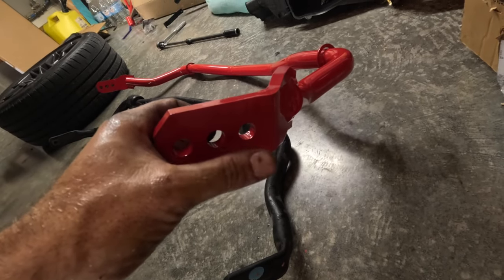Right off the bat, the adjustable sway bars are probably the first thing, or one of the very first things, you should do on any Mustang — especially the S650. It's incredible. It's my first time with an adjustable sway bar setup, and I don't know why I never did this before. I wanted to feel how stiff the front end could be, so we started in the stiffest setting on the front sway bar. The turning was so flat — it's really cool, interesting to experience — but there is a trade-off. Everybody thinks they're going to put big bars in a car and it's just going to be the best thing. Kind of not that way actually. You want the car to still have front-end grip. The stiffer you go, you could actually lose grip, and that's what happened in the front.